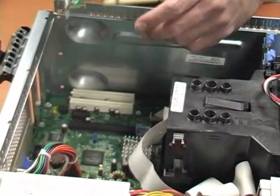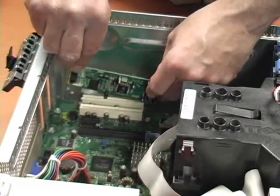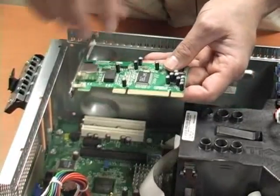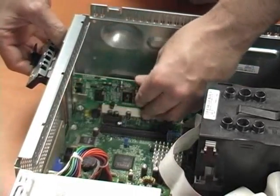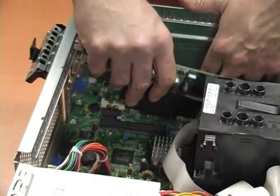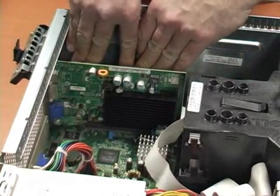What I'm going to do is I'm actually going to insert the NIC card into the motherboard. We're just going to put it in the expansion slot — these slots have numbers, and we're actually going to be putting this into slot 3. It's very simple to do. You're just going to be matching up the grooves on the NIC card with the grooves that are in the expansion slot. You want to make sure it's tightly in there. Now I'm going to put the video card back and close the case back up. The video card's in nice and tight, and my NIC card's in nice and tight.